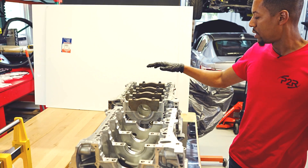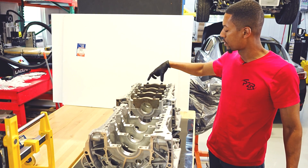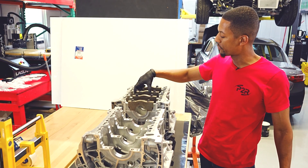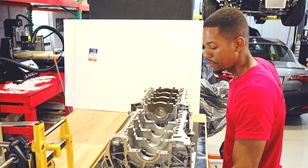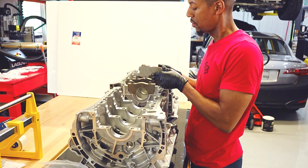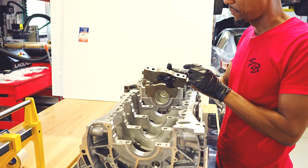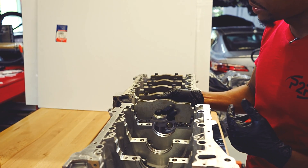This is the original J30A4 block. As most of you know, this is a four bolt main — two bolts coming in from the top and two going in from the sides. The major difference on the newer J30AC blocks, or the new TLX Type S, is that these use a four bolt main on the top and then two on the side, so you can actually call this a six bolt main cap.